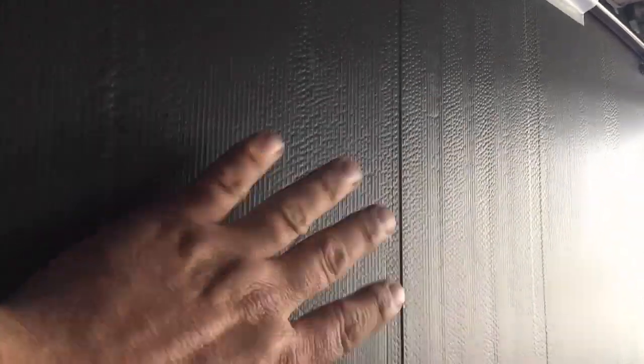But I will be using the 30mm foam on the walls there, because as you can see, it's a bit floppy. So what I did here with this core flute is I went — there's three pieces of 2.5mm — I did one vertical, one horizontal, and then came in with another vertical one just to give it some strength. But it's still very light, and I Sikaflexed them all together like a sandwich.